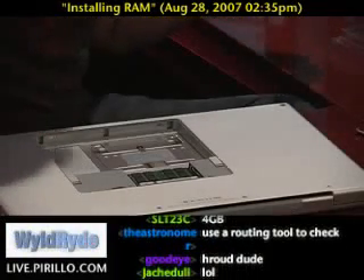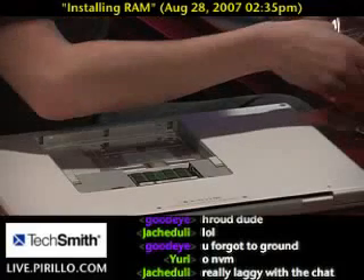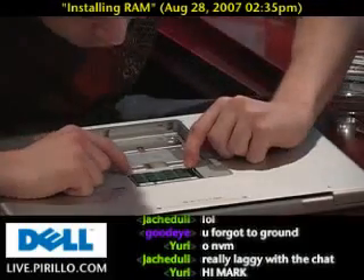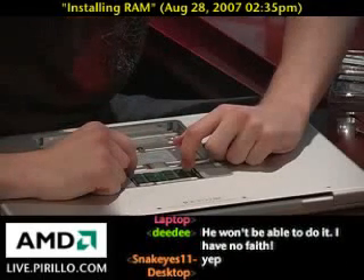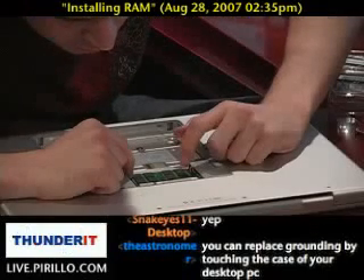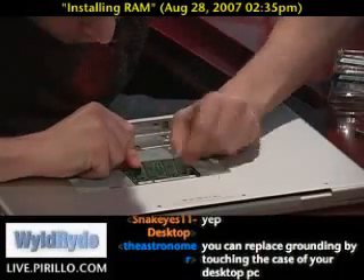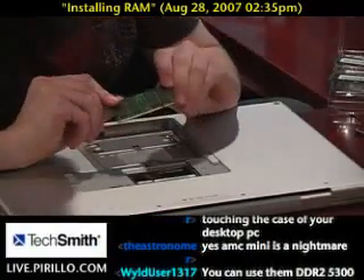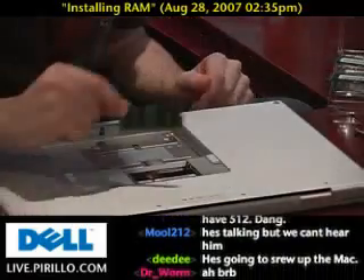I'm going to place this over here and hold on to these SODIMMs. I don't know if I'm going to be able to use them in my Intel Mac Mini. According to the place where I purchased this RAM, the Mac Mini I have is perfectly capable of handling the RAM I'm taking out, so I currently have one gigabyte in the Mac Mini. Upgrading RAM in a Mac Mini is a lot more challenging than in a MacBook Pro. For the bottom slot, I start out by coming in at an angle and then dropping it in directly. There's really only one way to seat the RAM — there's a notch on one end, so as long as you line that up, you really can't screw it up.